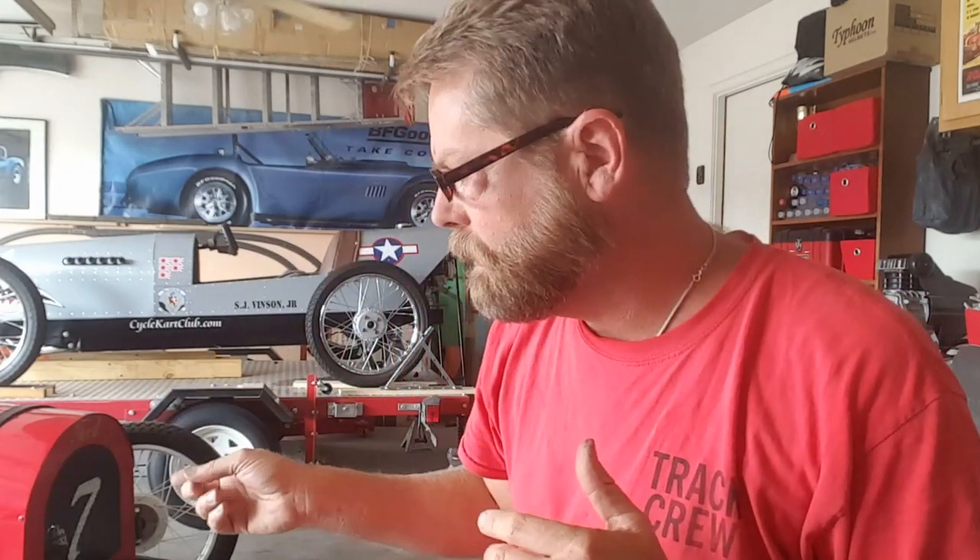I'm not going to show you exactly how to lace a wheel — there are lots of videos for that and people with a lot more experience than I have. Once you watch a few YouTube videos, it's pretty easy; not terribly complicated. The complicated part is truing it. I bought a stand from Harbor Freight for truing the wheel — a bracket with a rod and two adjustable pieces that clamp the wheel. Ideally, if you had bearings it would work great, but these wheels have had the bearings removed and the replacements don't exactly fit, at least for the rear. The front wheels have bearings, so you could probably use those.